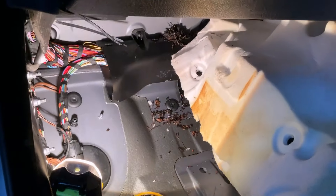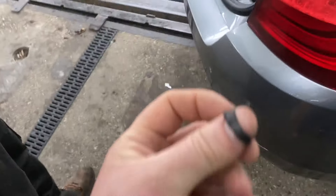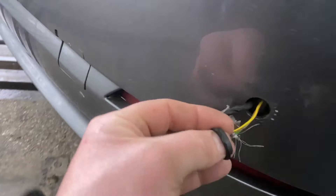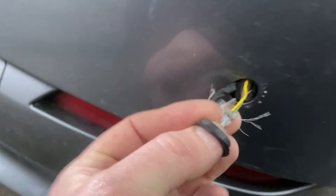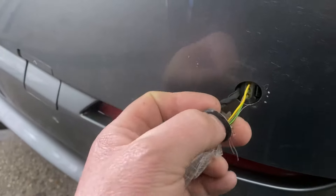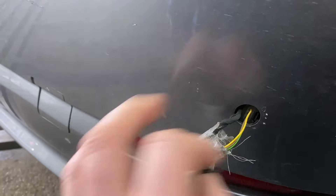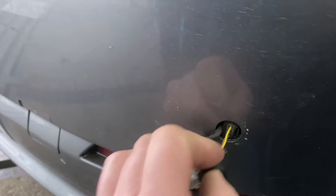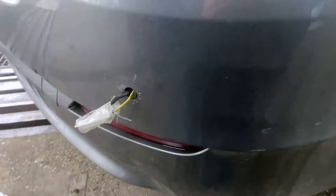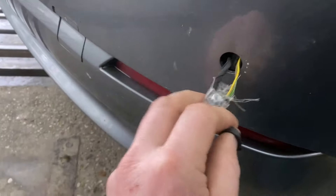Back to here - there's your gasket, found that in your glove box. We're looking at this and behind here you can see the sensor in the hole. I think it's the wrong way around, so we're going to have to drop the bumper off to get to it and get it fitted in the correct way. Even if you could get your hand right up under there it would be too tricky, so to do it properly we'll have to drop the bumper off.